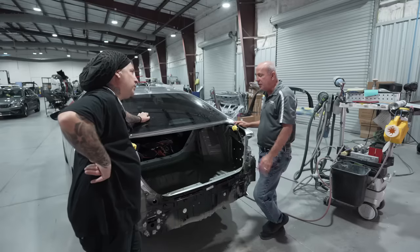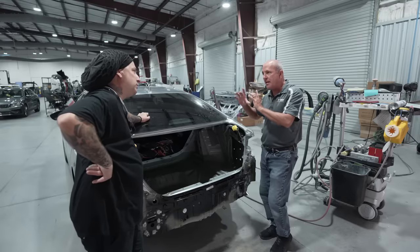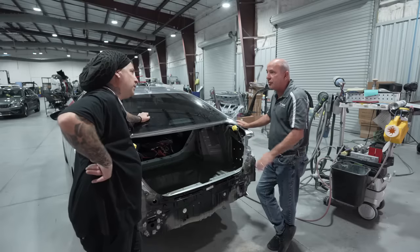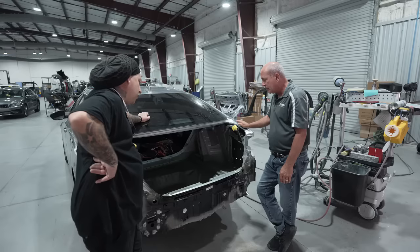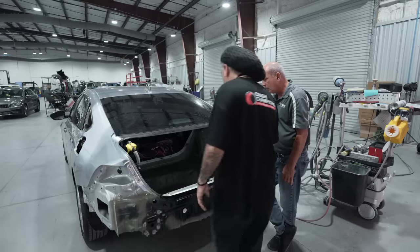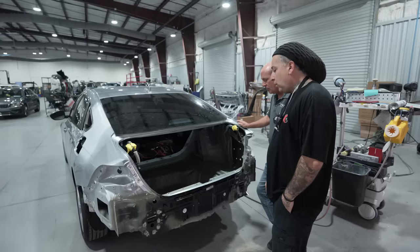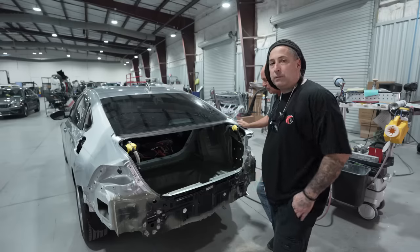Yeah, there's no waste. If you have some leftover base coat, you can mix it with the 100 MPT sealer, so there's no waste. Every bit of color gets used. Yeah, I like getting my cut-ins to look factory. That way the car looks like it was an undetectable repair. So I'll be definitely using that E-coat color chart that they have for the different cut-ins on it. So we got it all cut in. We're gonna go ahead now, prep it out, and get it loaded in the booth.